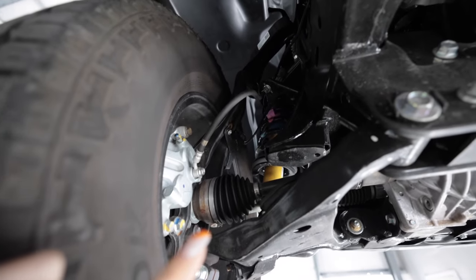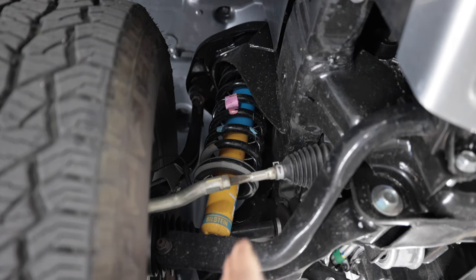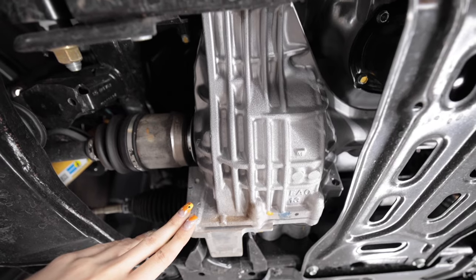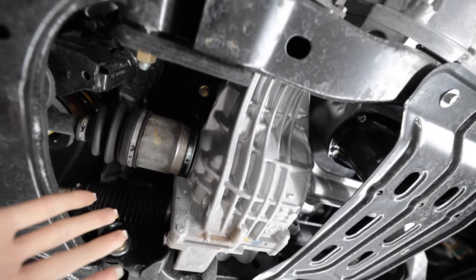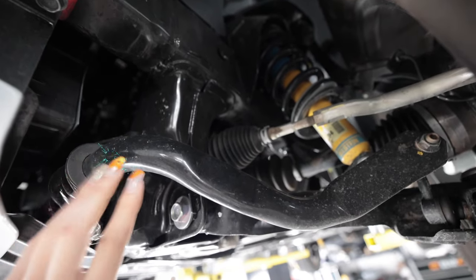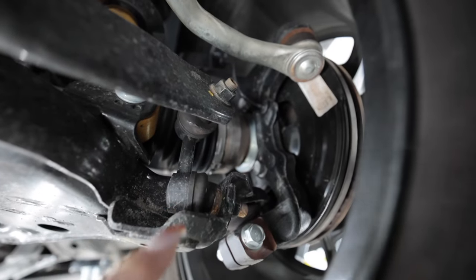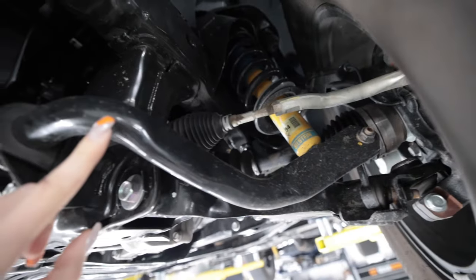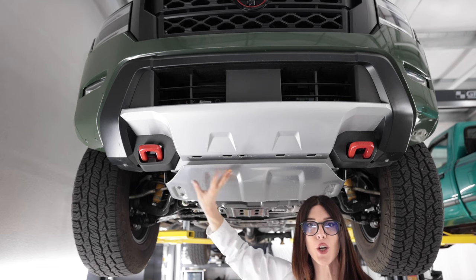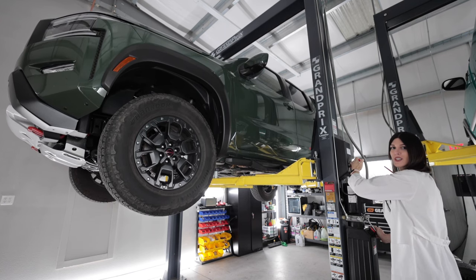Up front there is a double wishbone independent front suspension with a coilover strut. Take note at the angle — they're cambered inward from the bottom up towards the frame. You do not get a front locker with the Pro 4X, but look how easy it is to access this front diff — it's just right there in case you want to add one yourself. Another nice skid plate. Look at the side of that front anti-sway bar — that thing is girthy, especially at the end link, which is the size of a Sharpie: 25.4 millimeters in diameter. This front skid plate actually has like a silver gloss pearl finish — not necessary, but they did it and I like it.